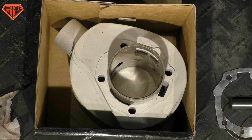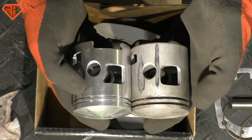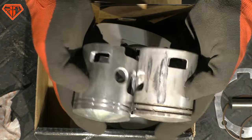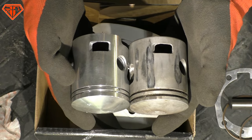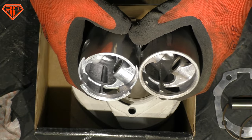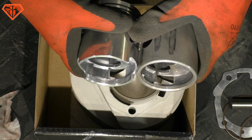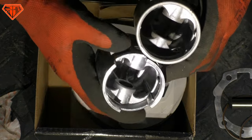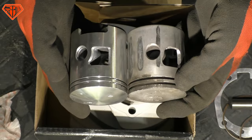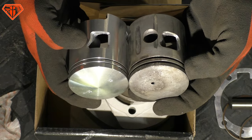Interesting. Anyhow, it's a little bit like original Piaggio versus the SIP 200. Shows that this window is a little bit bigger, it goes here. Nice. Boost port is tiny, as usual. It's even a bit smaller than the original Piaggio. And here this beam is thinner, you see? Also on this side, the window is a little bit bigger.